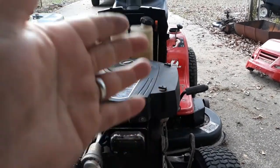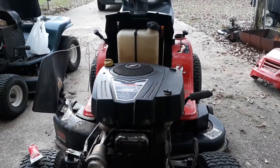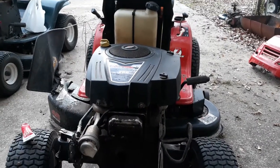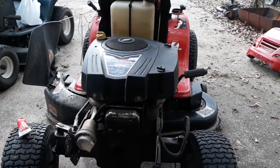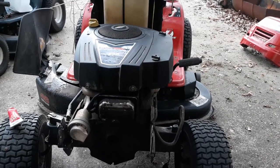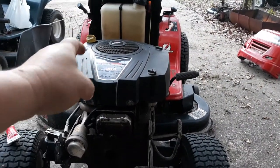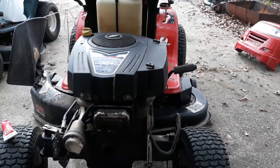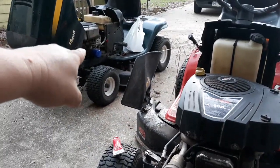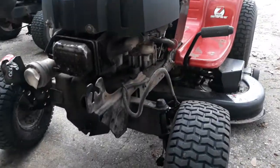What I did was take the 13-horse apart and grab the cam and lifter. I couldn't reuse the push rod out of the 13-horse because the cylinder was a lot shorter on that engine, so I went back to my buddy's and he had a set of push rods. Now, if you google the 20-horse Briggs and Stratton Intek, you'll see it comes with an oil pump and oil filter — same as the motor on my Craftsman over there.